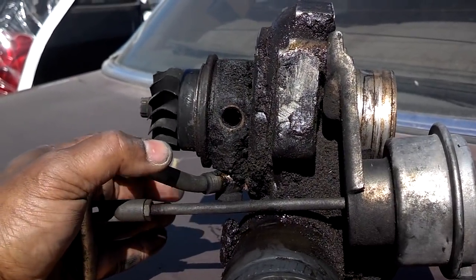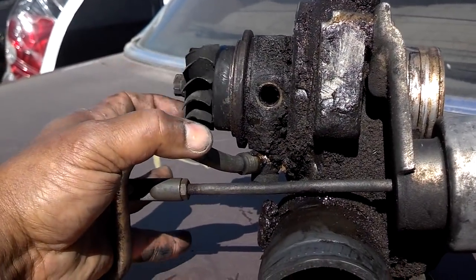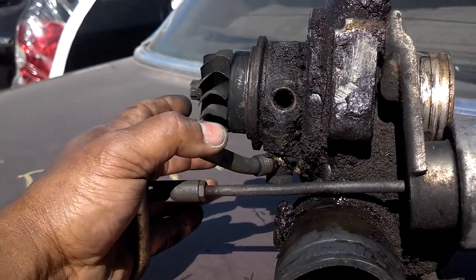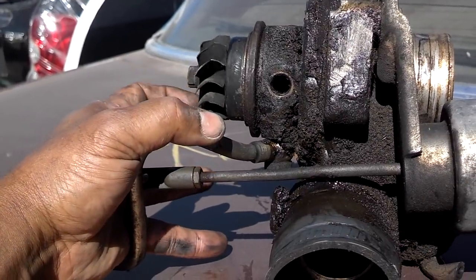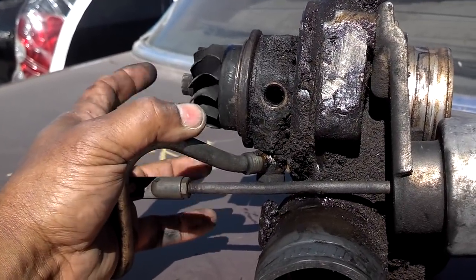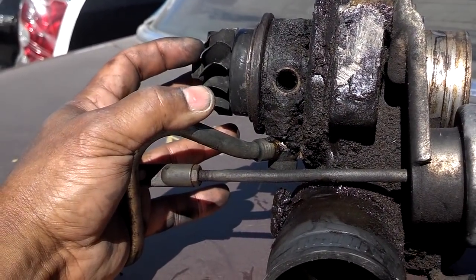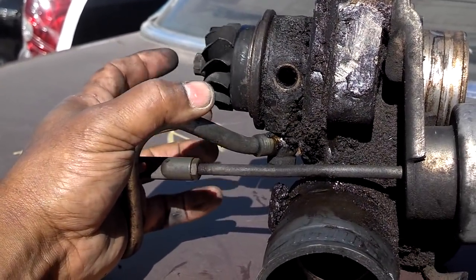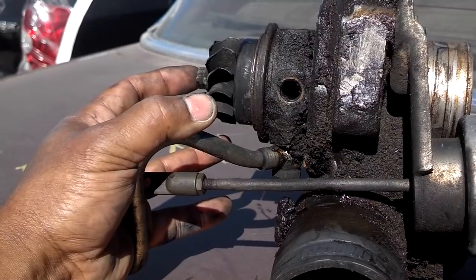Another symptom is that your car is not boosting as it should. The higher your demand, the faster the turbine spins and the more it will allow boost. Well, if normally your car is boosting at 8 psi and now it will only boost at 5 or 4, it may be that because of the wear of your turbine shaft it's just not able to spin as fast as it's supposed to. For instance, to maintain 8 psi boost it may need to be spinning at 15,000 RPMs, but if it's only spinning at 8,000 RPMs because of the wear, you're not going to get the boost you need.